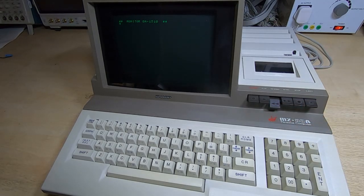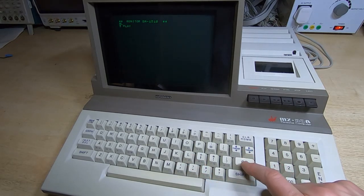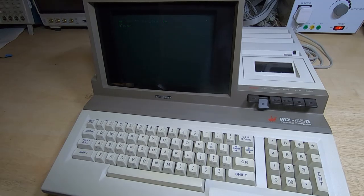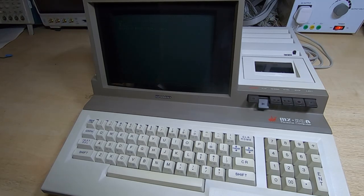Let's rewind the tape and see if it can identify that it's got a tape playing. That's looking promising — it's saying 'Loading BASIC Tutorial,' which is what's on this tape, and because it's read the title of the tape it means it can actually read it. I'll let it go through to the end to make sure there are no checksum errors — it doesn't take too long to load, about a minute and a half, so I'll fast-forward and stop if it throws up an error.